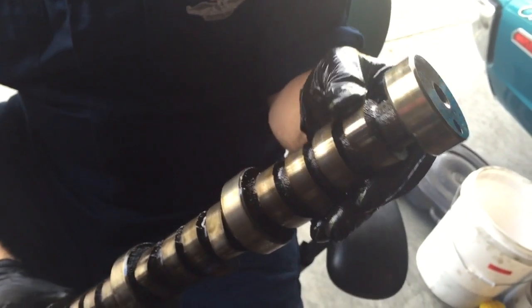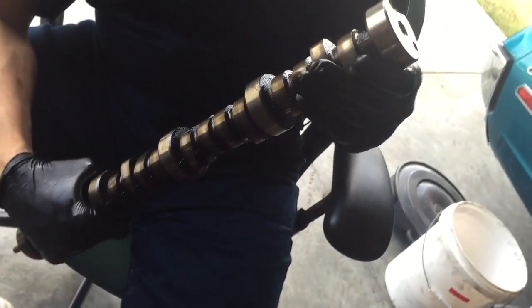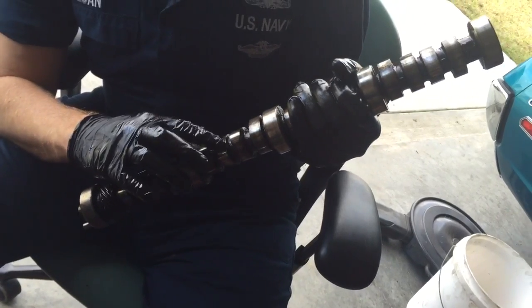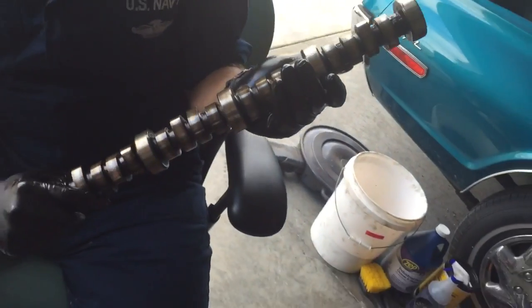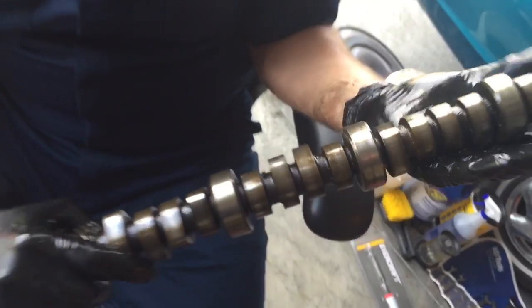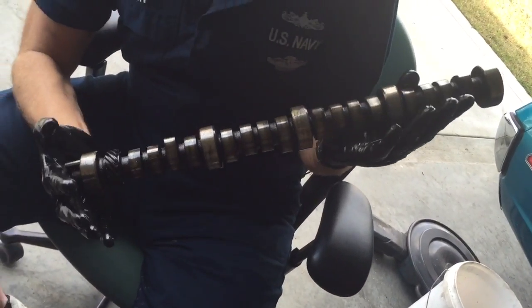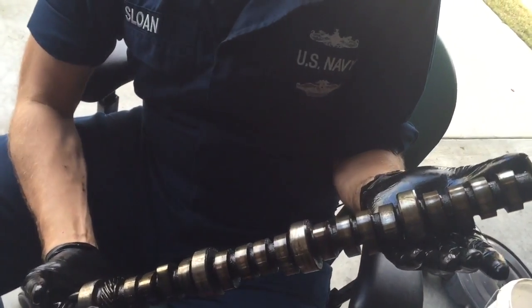Then you're going to want to inspect it, take a look at it, and we're going to take it to the machine shop to see if it's up to specs. You definitely want to look for any channels that are completely destroyed or missing — there are some that are chipped, I've seen in other videos. Ours have worn down a little bit over time, but are they still within specs? We're going to find out. Do I need a new camshaft? I don't have enough knowledge to know if this one's good or not. So that's the camshaft removal, and we're going to place it over there for further inspection by the machine shop.